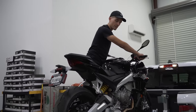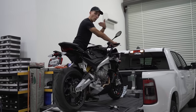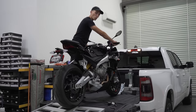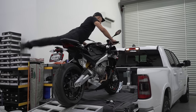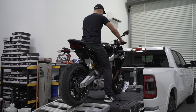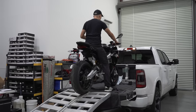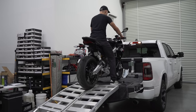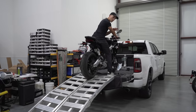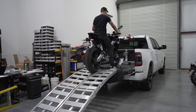Now at this stage, before the motorcycle starts going to the ramp and falling off the edge, you're gonna wanna straddle the bike and do it in reverse like you did to get it up there. So swing a leg over the machine, straddle it like this, and then watch your back. Make sure the motorcycle is nice and straight, have both feet down, and then feather the brake as you come down. This is gonna require a little bit of balance, so you're not gonna wanna be an uncoordinated duck and just have the motorcycle flop over.